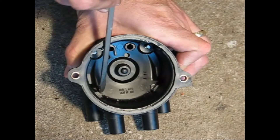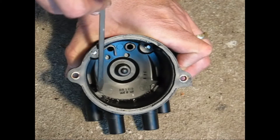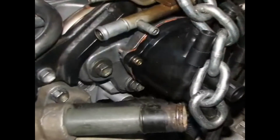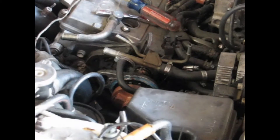More horsepower. Unbolt the two 14mm bolts holding the distributor onto the head. Once these are removed, the distributor just pulls on out, with a little wiggling.